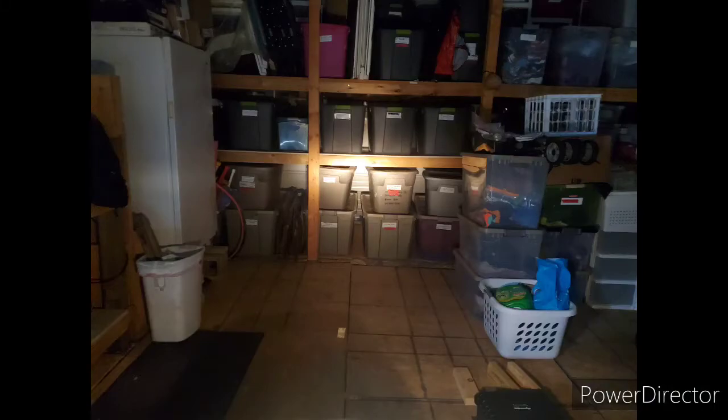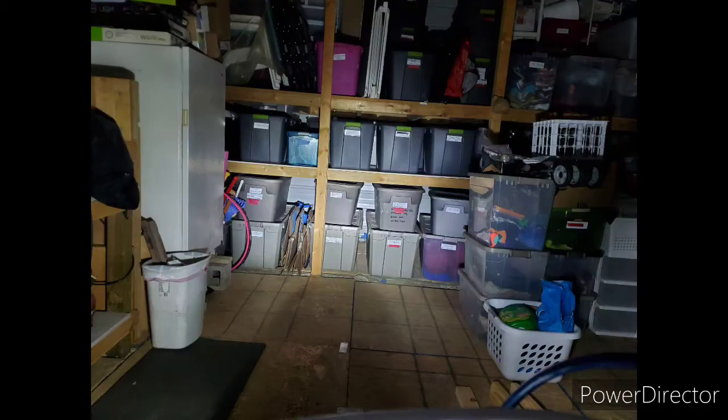This is a before image of the 35-watt incandescent headlight. Before the DC conversion, it would be much dimmer at low RPMs or if I pressed the brake. This is the new high intensity LED — as you can see, it is much brighter.